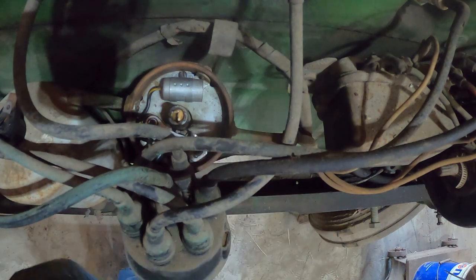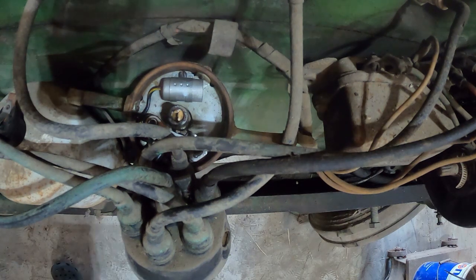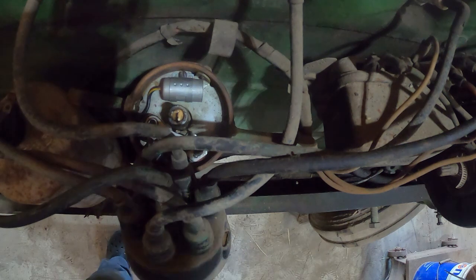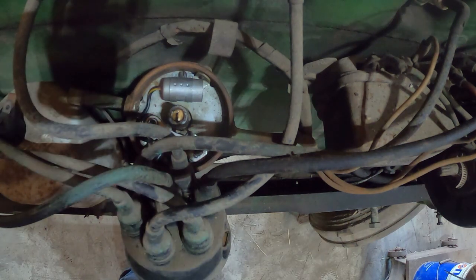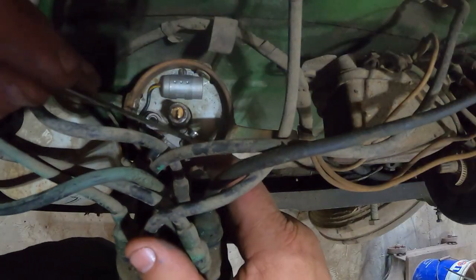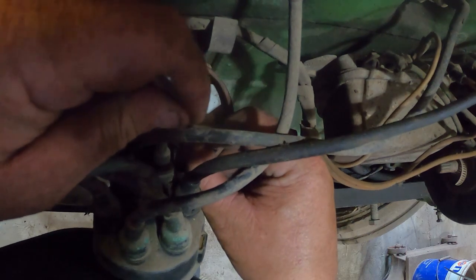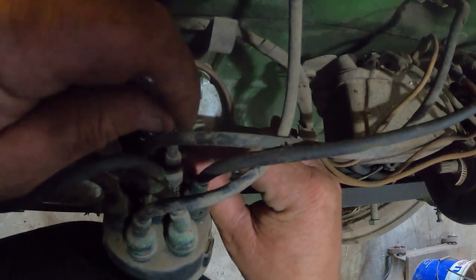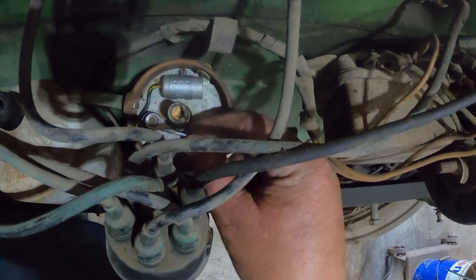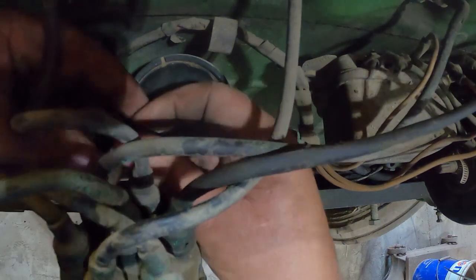Is that a bad coil? Is that the one I took off the 660? It just might be. I'll get the point file, clean them up. If I can't get it to spark, then I will find another coil, because I think this one might be junk the more I think about it. I guess I just need to throw those things away. About 20 thousandths. Where'd you go, rotor? There you are. Probably won't work without that.